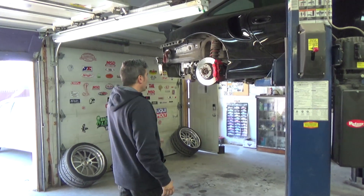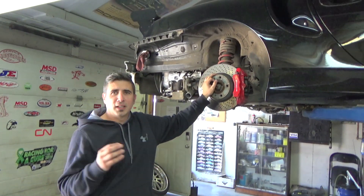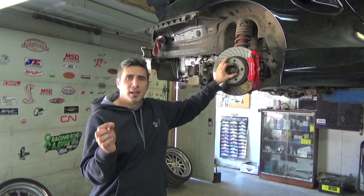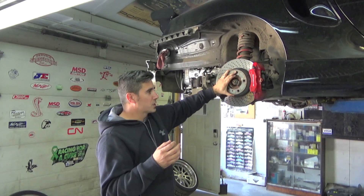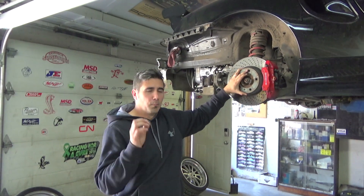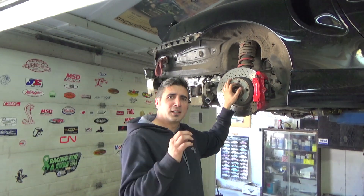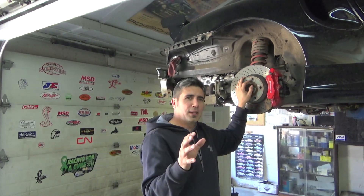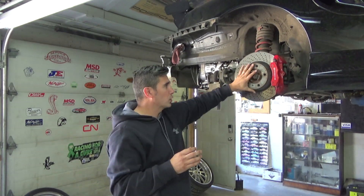After all this work, the ultimate gains from this relatively inexpensive upgrade are in the neighborhood of about 80 to 100 horsepower and a good 100 foot-pounds of torque. That should take this car from what was considered a fast car in its day to an extremely fast car, and you will definitely feel that by the seat of the pants more than just on the dyno. If you don't mind hollowing out the cats yourself and sending the ECU in, with the coil upgrades you might be into it for about three thousand dollars — relatively low cost for a Porsche.